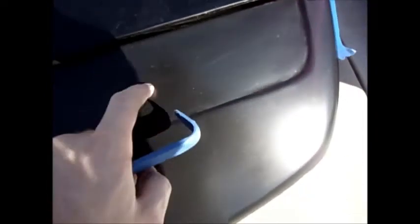When you get your bumper, if you get an aftermarket bumper, what you want to do is get it in the sun for at least a couple of hours so if there's any air pockets — I found a couple on this one right here and already popped them — you'll see a little bubble in there. If you push down on it, it's a little tiny air pocket. All you got to do is pop them out; you can use a screwdriver, needle, whatever. Then you're going to add a little bit of filler in there, or you can use some glazing putty. That's how you find the imperfections or any little air pockets in your bumper.